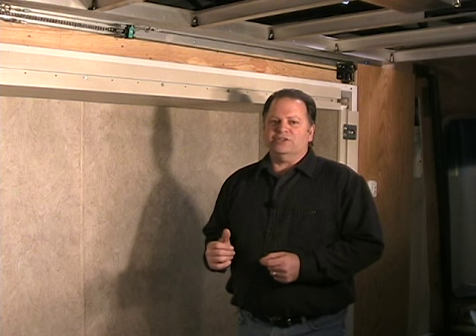The AccuSlide system differs from conventional slide outs in the fact that it pulls in and pulls out. Conventional slide outs push the room out and pull the room in, usually from a device attached to the floor or the outside wall of the coach at the floor area. The AccuSlide uses eight cables — four attached to the inside corners, top and bottom, both left and right, and also the outside corners, top and bottom, left and right. As a result, you get a much smoother operating system where the room is actually controlled from eight points instead of just two points at the base.